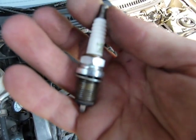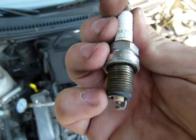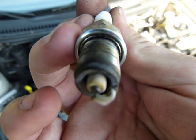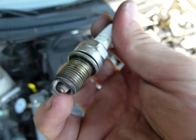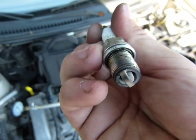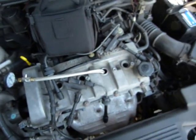Other than being sooty here at the end of the terminals, they are looking fairly clean and nice. Sooty is fine — and even so, it's barely any soot here where the spark is being generated. The electrode is there in good shape; nothing is molten or distorted.